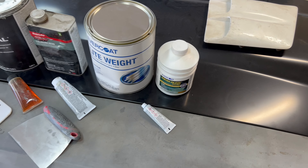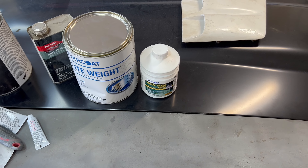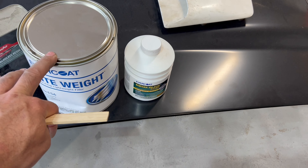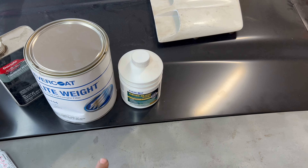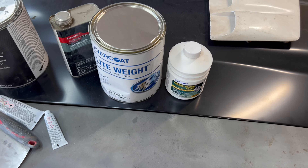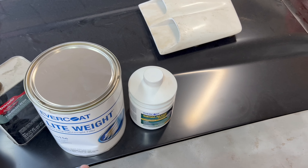If you're just doing basic body work on a car where you haven't done an extreme amount of metal work — hanging quarters, patching fenders, or modifying door edges — you could probably get away with just these two products, or actually probably just this one and a little bit of fiberglass resin. Because here's what most body shops use — it's all you're ever going to really need, because you're only taking care of small blemishes or minor imperfections. You typically use this first to take care of all your major dings, distortions, or problems you couldn't work out in the metalworking stage, and get that sanded smooth.